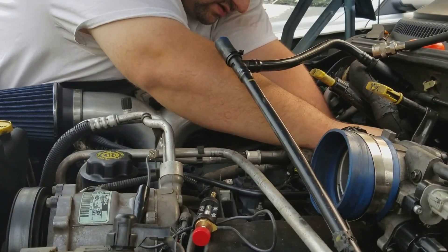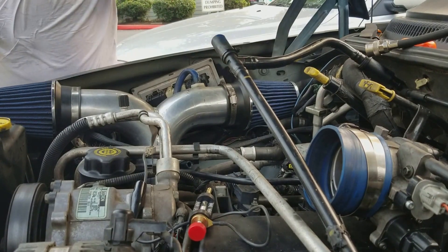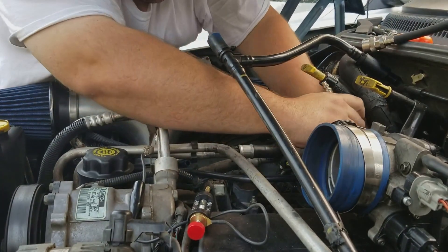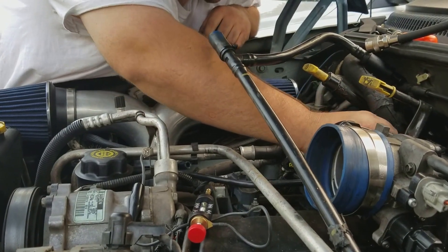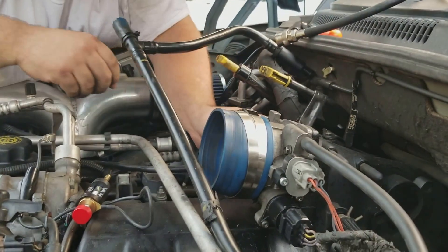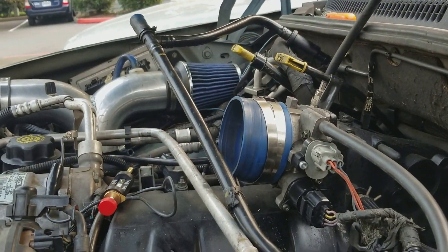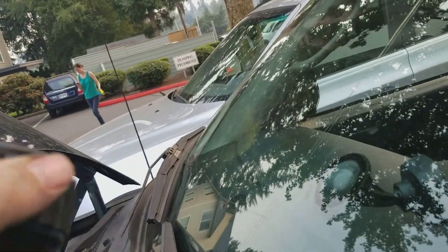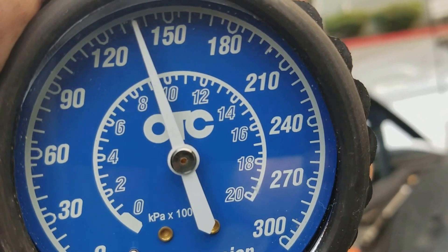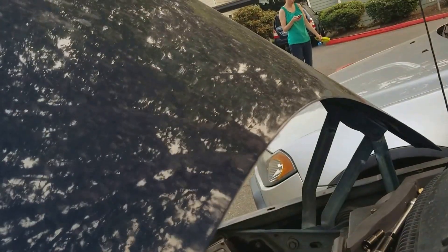These cylinder 7 and cylinder 8 get to be a little more tricky. We've got to have the size hands of a 6-year-old to get back there almost. So we're going to take the hose, thread it in. Connect your compression tester. Watch that gauge — we'll give it 5 rounds. Only 130. 130 on cylinder 6.